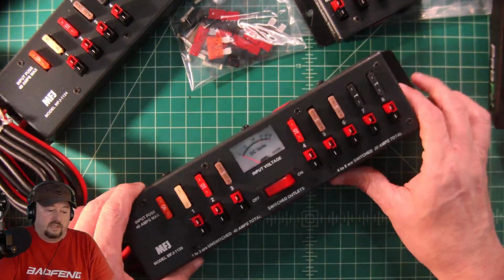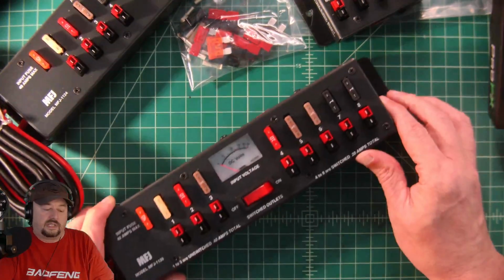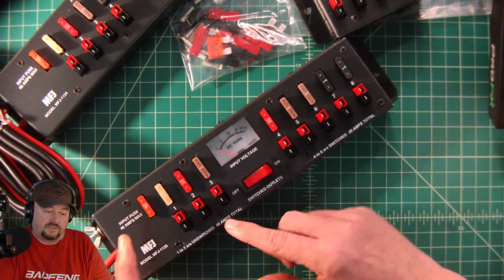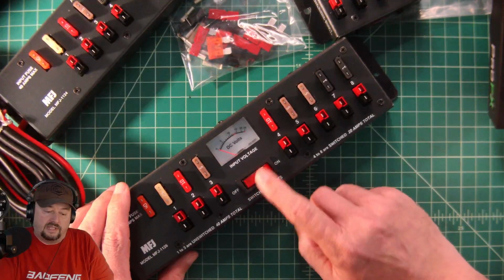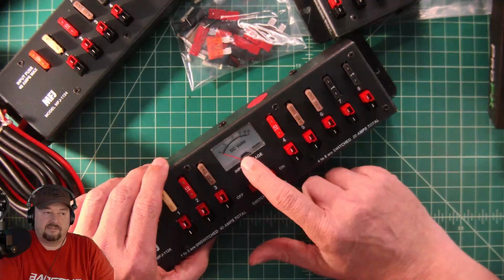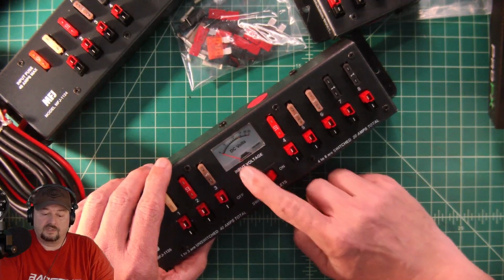Again, we have the ring connectors on this thick, heavy gauge wire that feels pretty good. And again, we have a ground lug here. And when you take a look at this, it tells you that your input fuse max is 40 amps. So this is a 40 amp product. It does have these mount holes where you can connect this up. And then taking a look at this, it has 3 that are unswitched, 40 amps total. So that means you run 40 amps total out between these 3. And then you have a switched outlet here where you can turn this on. We also have a little bit of a DC voltmeter, which is handy in some cases. Where mine's mounted, I can't see that voltmeter, so it doesn't do me any good. But you might be the type of person to mount this in a place where you can see it, and then you can monitor your voltage usage.